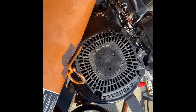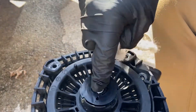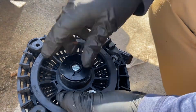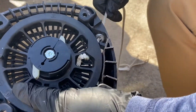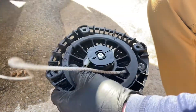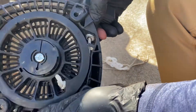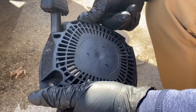I'm going to take that last bolt off and then I'll restring it. This was a miserable job because the old rope was all jammed in here. I don't recommend taking this off because sometimes the spring pops out and it's a real big pain to get back. So what I like to do is just manually spin it by hand until the holes are kind of lined up, and I tie this end off. I needed two hands otherwise I would've showed you. So I tie that off and then I just feed it in this way. This cord was actually a little thicker, so it was pretty hard to do. And then after you're done, make sure you can pull it all the way and it retracts nicely — because if you spin this too many times, you'll use all the tension in the spring. So the recoil is good. Time to put this back on.